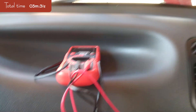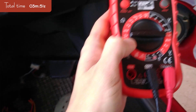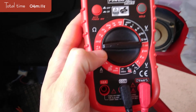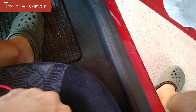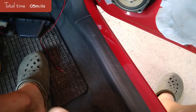I'll be using the multimeter, set to the beeping or diode mode. Once you connect the two leads together, we have a beeping sound. This is what we want to hear, and that will mean that we have a connection.